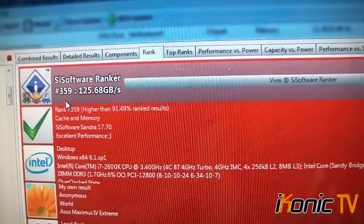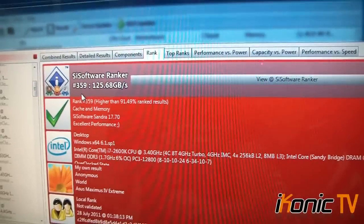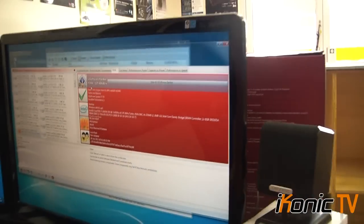This is pretty much not very expensive memory — it's not running at 2,500MHz. What you get here with this RAM is extremely fast 1600MHz memory. I was able to overclock it to 1700MHz with ease, and I could obviously push it higher to 2000, but then I'd lose a bit of the timing. So like I was saying, it's CL8 memory, DDR3-1600, aka PC3-12800, and it really is fantastic memory. It retails for 780 Rand — a very good buy. Please be sure to check us out at iconicart.co.uk. Thank you.